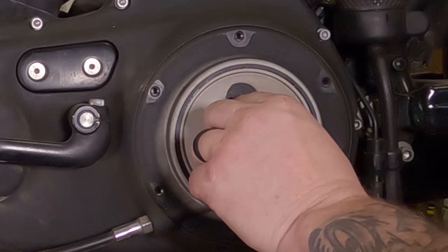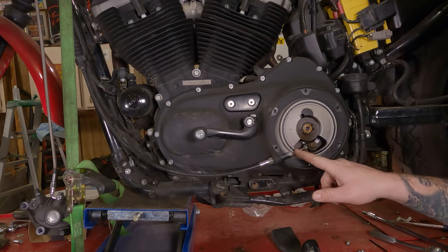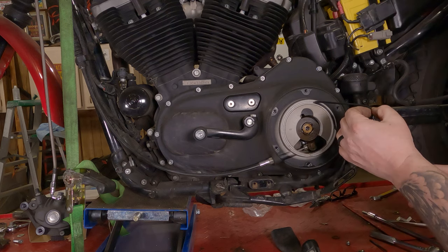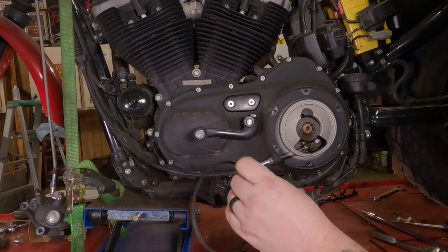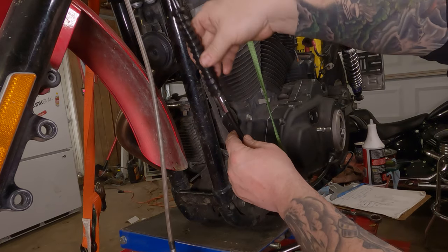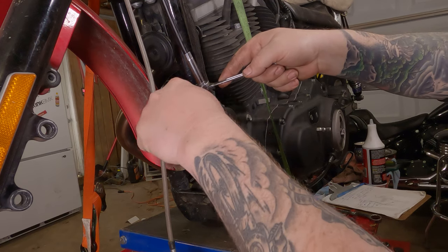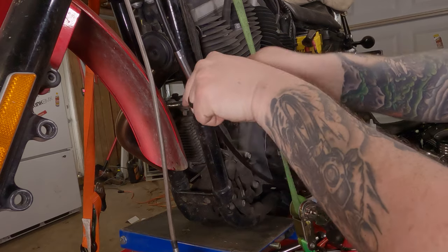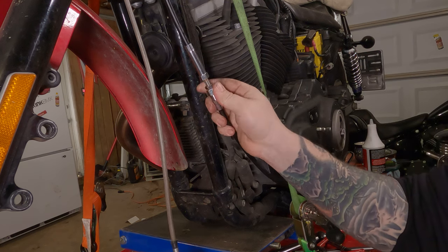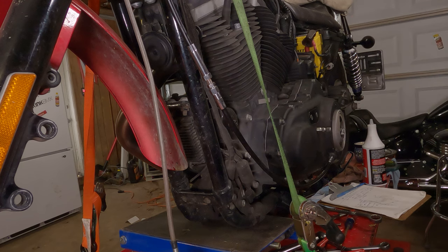There was a hex bit and a spring that needed to come out of there — that sits right back up in there on those little flats and that's what holds the adjuster tight. Put that piece inside your clutch cover. To replace the seal, take a knife and put it underneath here and peel this seal right on out — or use your fingernails. When loosening your clutch cable, take your clips off or cut whatever zip ties, lift your rubber slinky up and try to get it out of the way. Hold onto the cable with two wrenches, loosen the jam nut up, spin the jam nut way down and out of the way. Then take this bottom section — which should spin — and thread it all the way in to give you all the slack you need on the cable. That will help you get the clutch cable unhooked at either end.